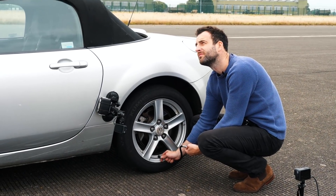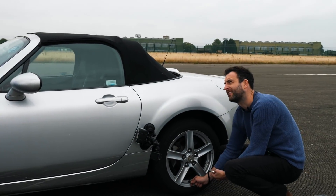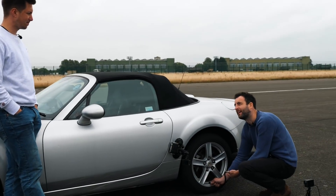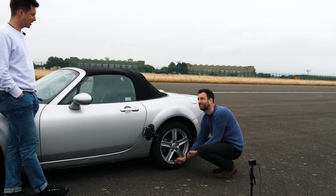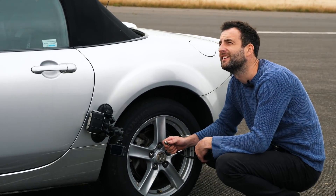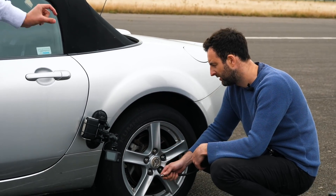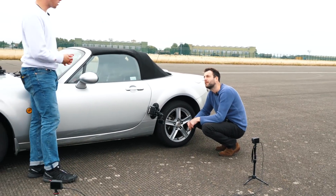Around 20 we're getting towards peak — optimum for a tyre like this I would say — because I'm not sure whether those dragster pressures are just for a dragster tyre. And there's so much tyre to sink down and spring back, whereas here you've got not very much sidewall, and the sidewalls are much stiffer in road car tyres.